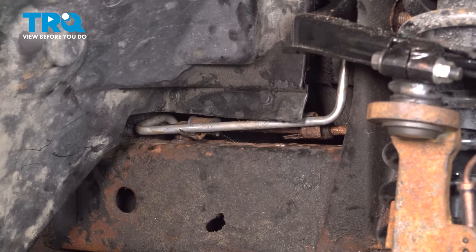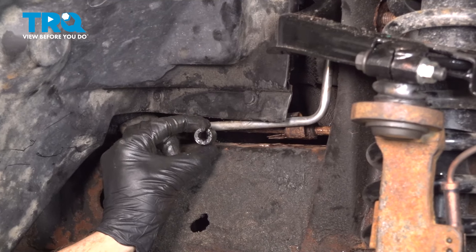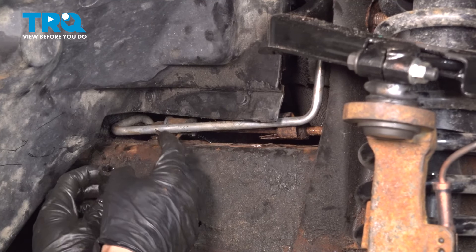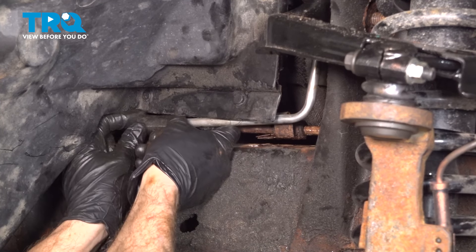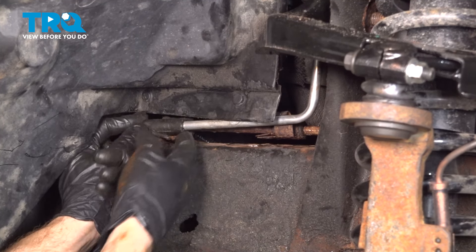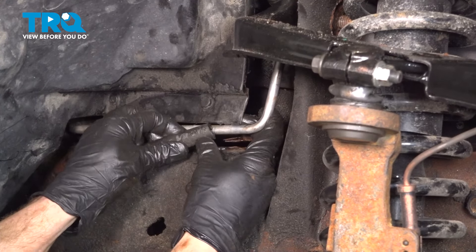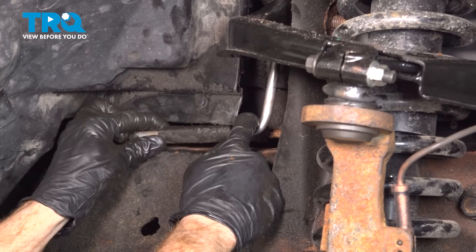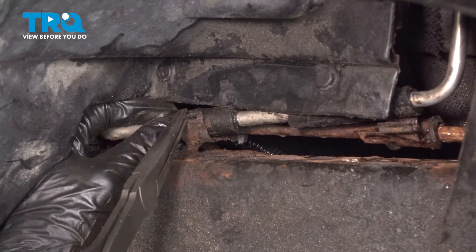Ours have already been replaced — somebody just put on a little bit of hose. When you do this, it's important to use a little bit of grease because we want to prevent moisture from sitting in between this and the line itself — that will cause rust and they're going to start to leak. Get the rearward one in here, bring that down, and while we're down here, start flexing the brackets into their proper positions.